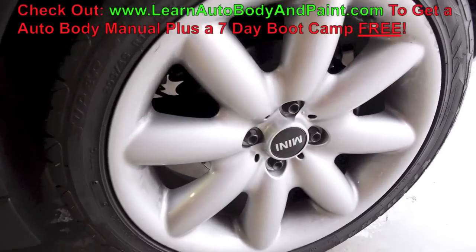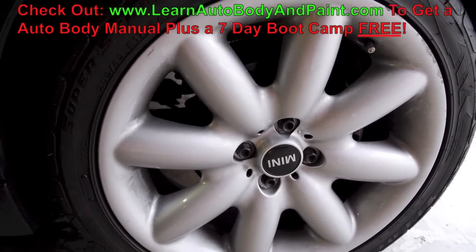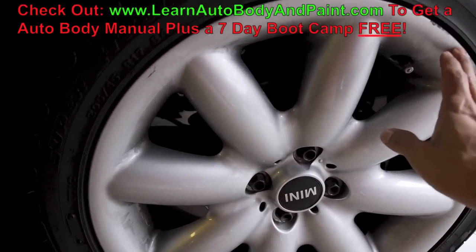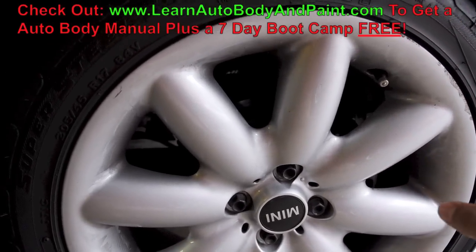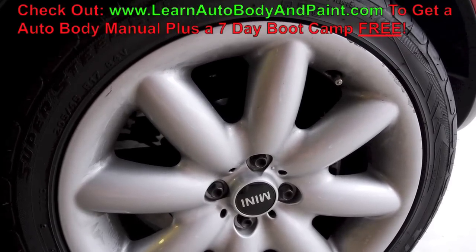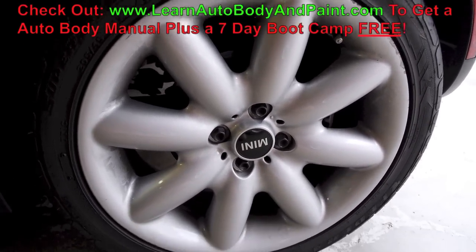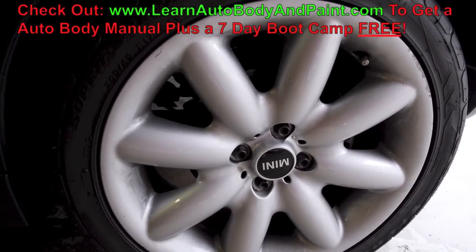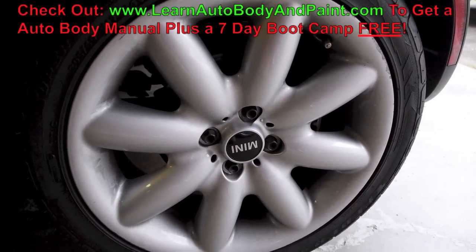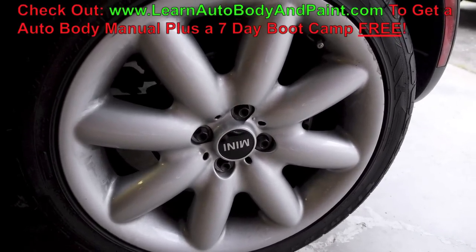Our rims are a little dirty. We do have some scuff marks and scratches on them, but that's okay — in this example we're just going to go ahead and paint them flat black. If you want, you could sand these out, add a little epoxy putty, do a little body work on the ridges to make them look like new, then give it a coat of primer and paint them. In this example, we're just going to get some good degreaser soap, wash the rims, make sure they're really clean, then dry them off really well. That's important — make sure they're really dry before you start painting.